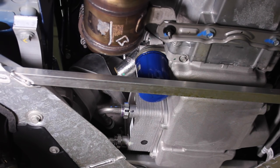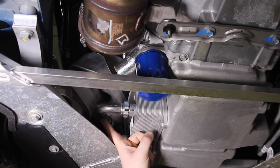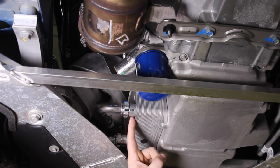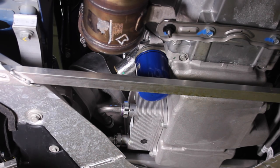As I touched on before, the lower radiator hose has three branches — two for the auxiliary radiators, and then one for this oil cooler. The coolant comes back from the front of the engine, exchanges heat, and then goes back into a port of the engine. And that's how the oil cooler works.